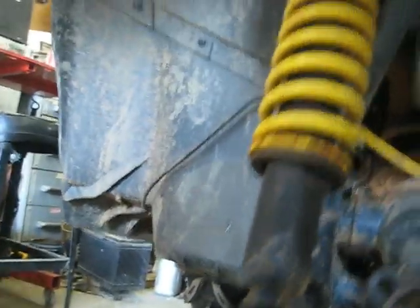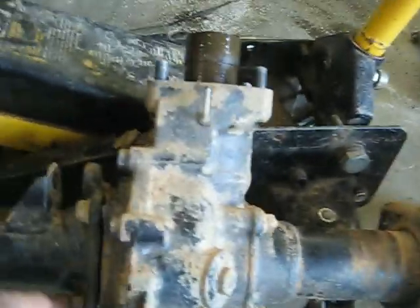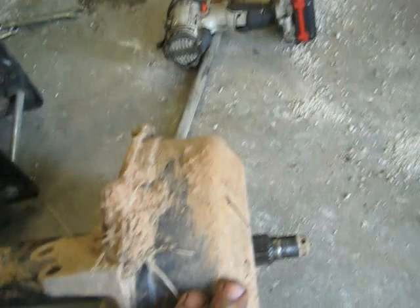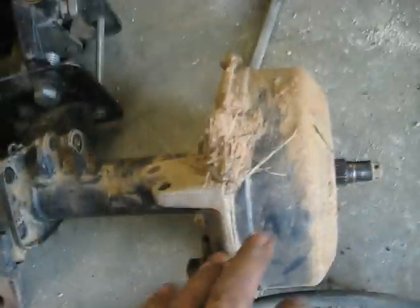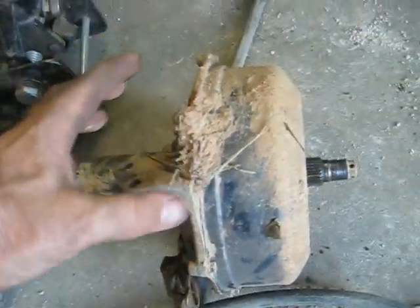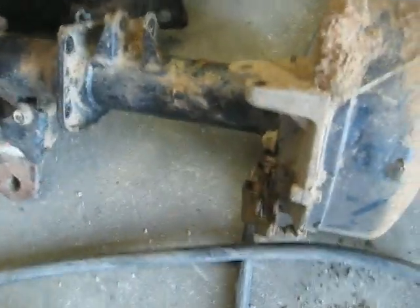It kept the drive shaft up in here. There's a lot of mud in the drive shaft as well as in the end here, so I can only imagine what the inside of the differential is going to look like. I've already got these nuts loose - slide that shaft off. We have to take the brake side apart, unbolt these flanges, then slide the whole axle out and take this tube off.